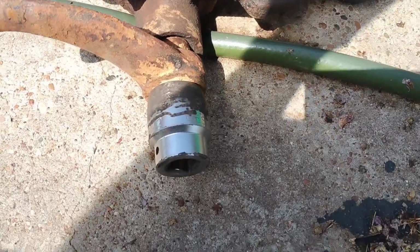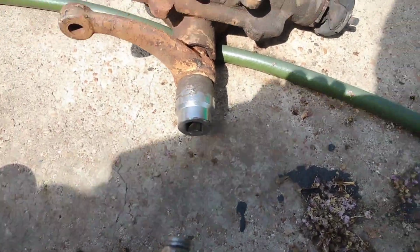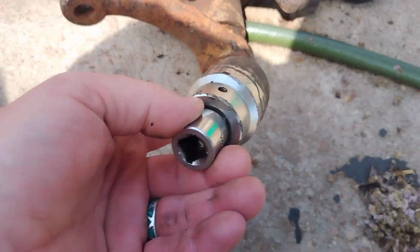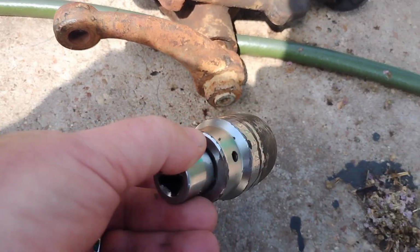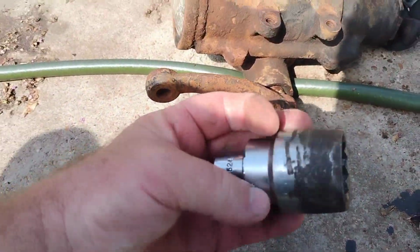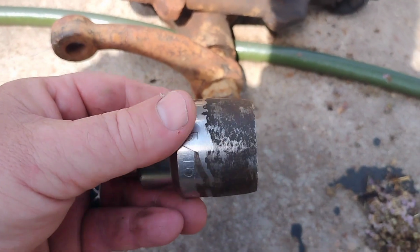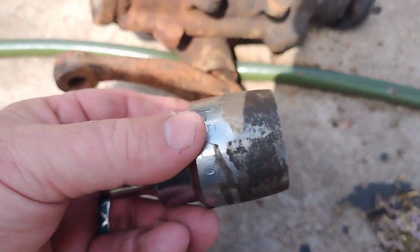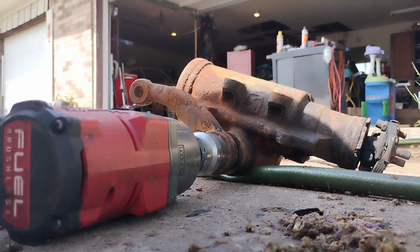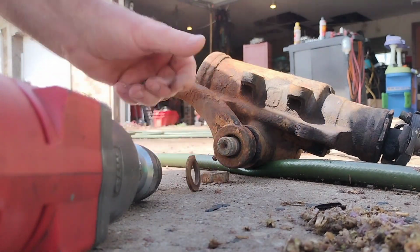So you need a 1 5/16 half drive socket to do the pitman arm nut. Just saying. But mine is actually a 3/4 drive, so maybe that's after 1 1/4 and you go bigger, that's when it's 3/4. So I got a 3/4 to half drive reducer. And then I had ground this because I was doing some gears. Maybe it was on a 9 1/4 Dodge pickup. I don't remember, but I had to clearance it to get it to fit in the yoke to get the pinion nut or something. I don't know, it's been a while. Piece of cake.